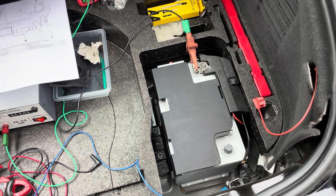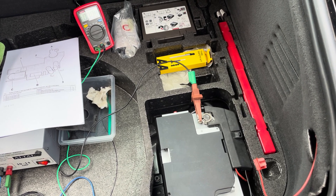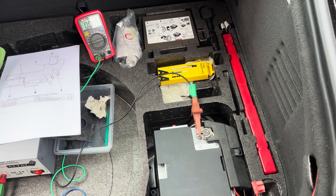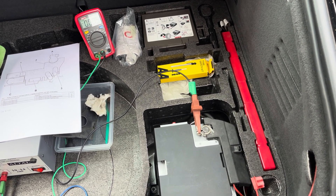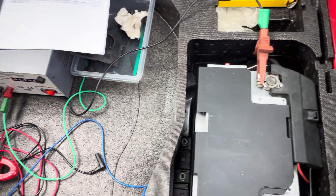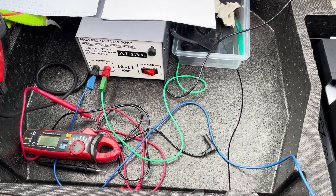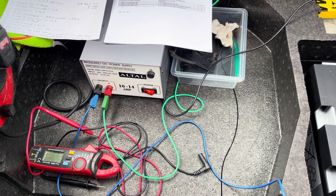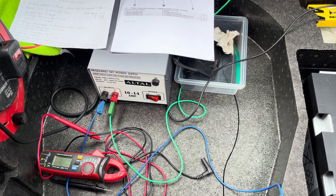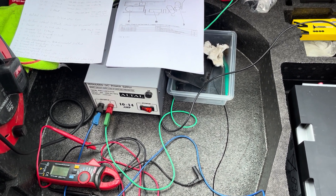The approach I took to fault finding: I've read lots of things online about different techniques for detecting unwanted current draw. What I did is I didn't want the battery in circuit, so I disconnected the ground connection, left the positive connected, and used a bench power supply — a 13.8 volt or 12 volt supply capable of 10 to 14 amps. That's enough for small loads, but in a car the currents are quite high, so you certainly can't bring the ignition up as that will start energizing glow plugs in a diesel and draw far more current than the supply allows.